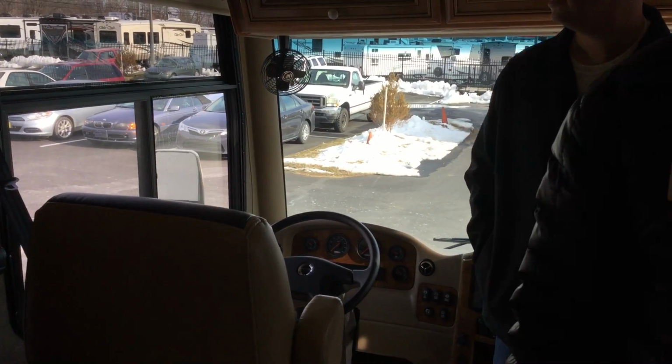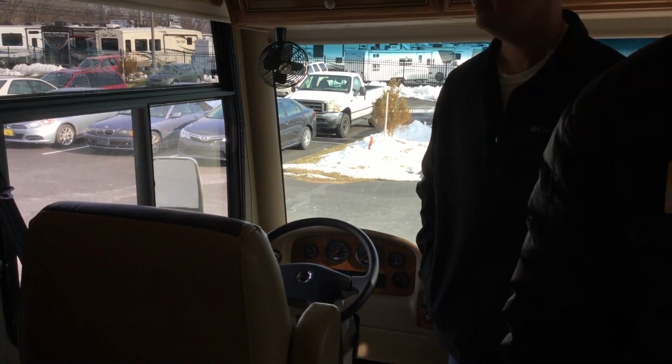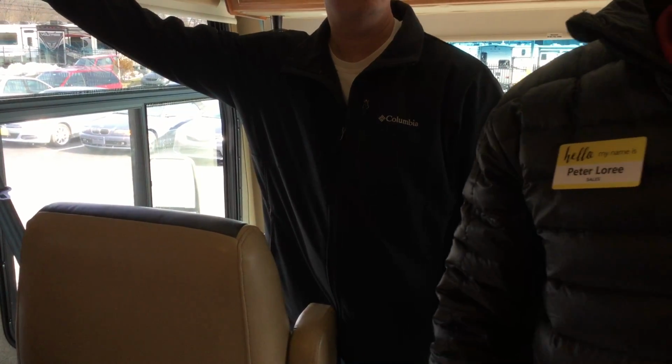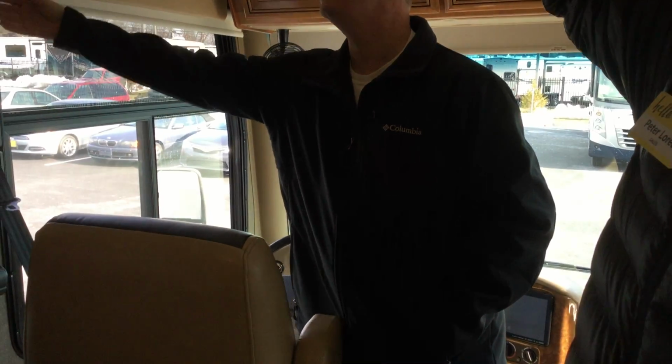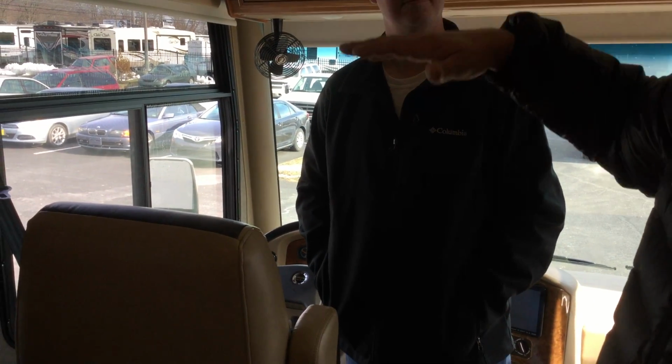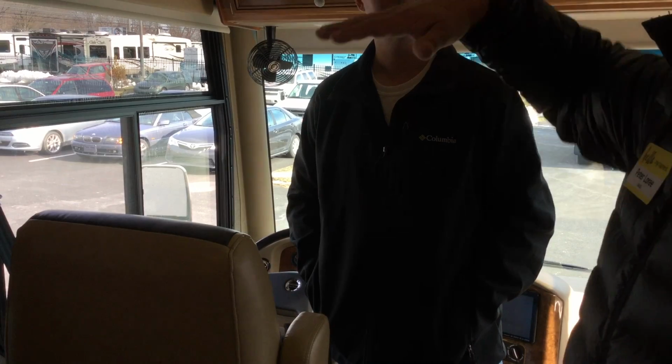I'm gonna tell you a trick about this bed. Those stretchy bands work too. What's the key for? Just to lock it when you're traveling. So this bed is on a timer motor, an electric timer. When it starts coming down at an angle or going up at an angle, it means it's out of sync. The only thing you have to do is rock the switch back and forth about 10 times, and then it will sync itself. Then you should be good to go.